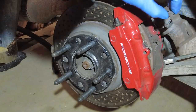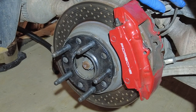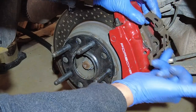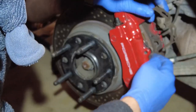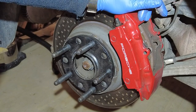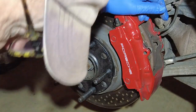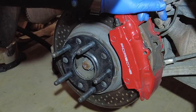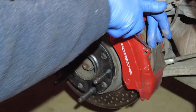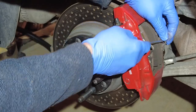Take the spring off. You may have the brake pad wear sensor line — I've got mine tied up because I don't use it. That line clips in here and goes down into your pads. I don't use that since I change my pads very frequently back and forth for the track — I always know what state they're in. After that, it's just a matter of pulling the pads out and they slide right out.